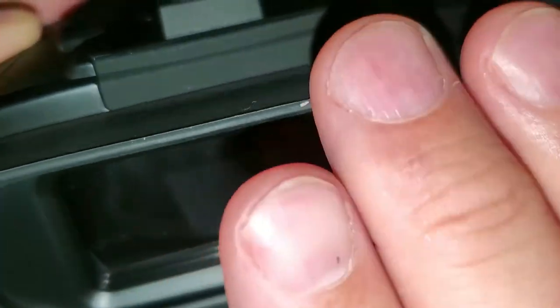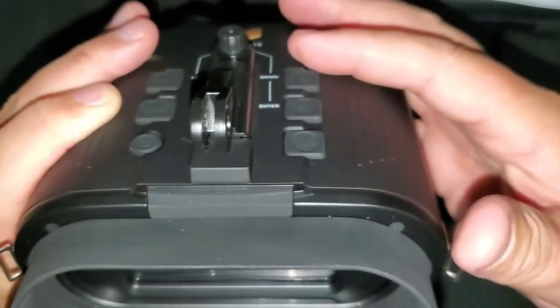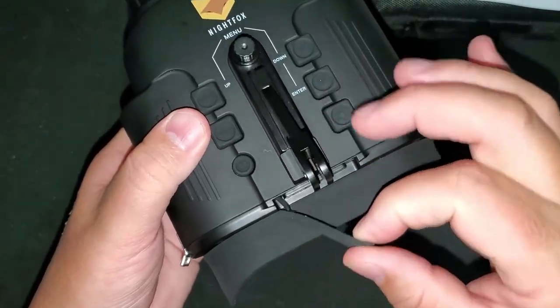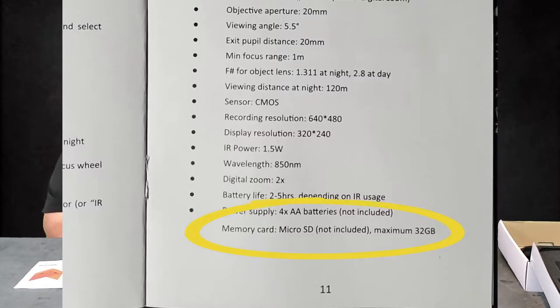What's really cool is this takes video. You can download or upload whatever video you take to your computer. This little flap right here in the front exposes a memory card slot — I have a memory card in there, and it's just a micro SD. Now there is a limit. This is an eight gig. I tried a 64 and 128 gig and it said card error on the screen. When I looked it up — I did have to use the manual — it said there was a card limit of 32 gigs max. I didn't have anything in between so I just put the eight in there.